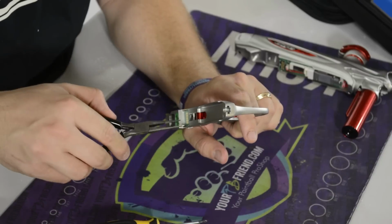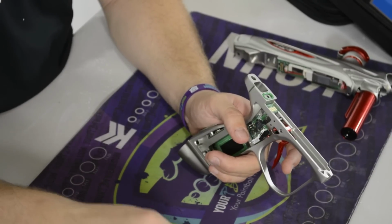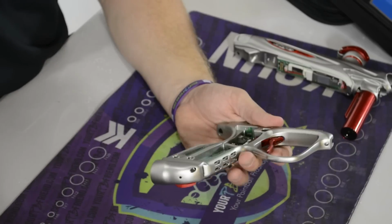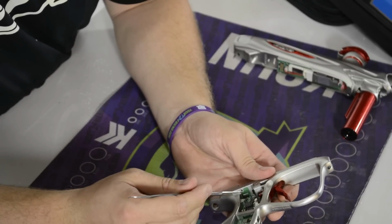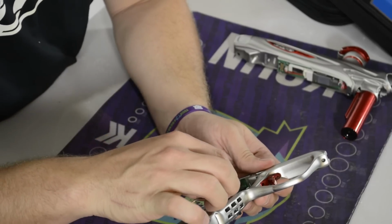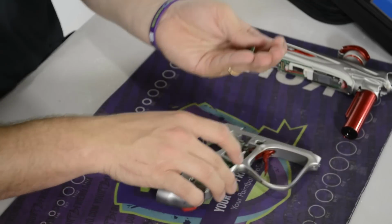One, two. I like to bring needle nose pliers, small screwdrivers, and the proper picks and tools so that you're not forcing anything. You want it all to come out smoothly. On the inside here, you will see that the main board clips in with little pins into that contact system. I'm gonna take a non-sharp surface and push, and it pushes this out.